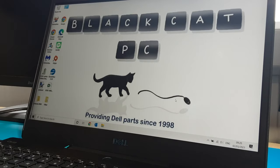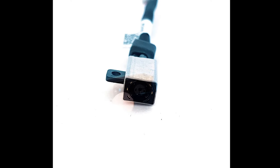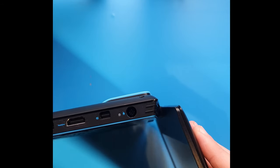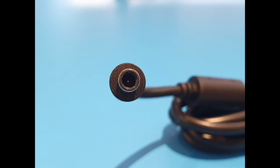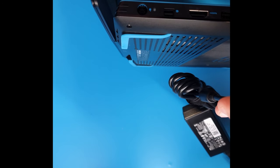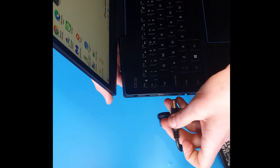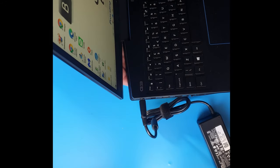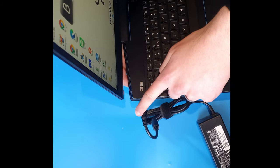If this didn't fix your laptop, I'd recommend checking the pin in your adapter, and also checking your DC port. Inside the DC port you'll have a center pin with four or five pins going around the outside. In your adapter you also have a center pin — it's normally recessed by about five or six millimeters. Don't try bending it back because it will weaken the pin and cause problems later. Also watch out for the very common issue where the adapter only goes in part way — this could be the DC port or the adapter itself.